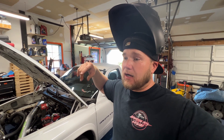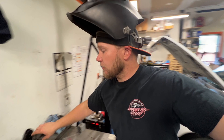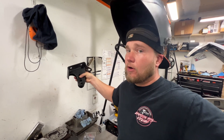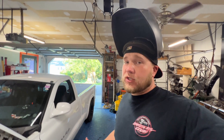I can't adjust the front of the bar because the way the truck is lowered it only allows me the bottom hole position. But the brackets I bought have adjustment in the rear. I had it in the third hole down and moved it back to the second hole - more like a stock cal track - so they're still going uphill, just not as aggressive. It'll be about two weeks before the next test and tune, but I wanted to show you guys these updates.